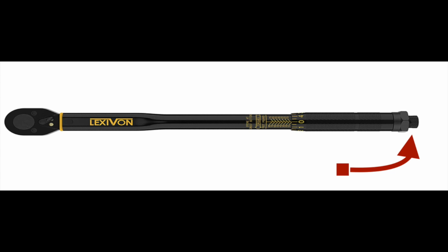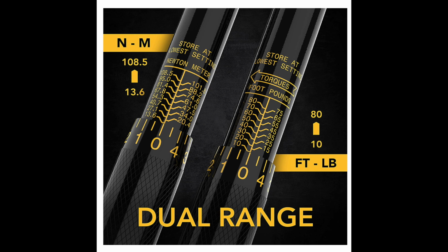At the bottom of it, you want to loosen up the cap on the bottom, and then at this point you can dial into the torque that is recommended. So you would line the 0 up to, say, the 70 mark for the outside hanging lugs, and then dial the numbers to number 5, so you'd have 75.